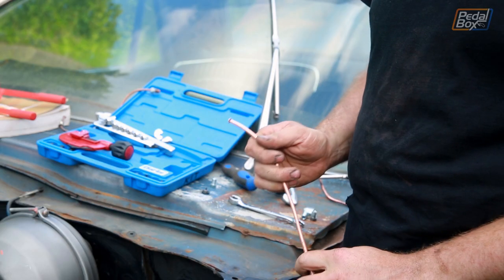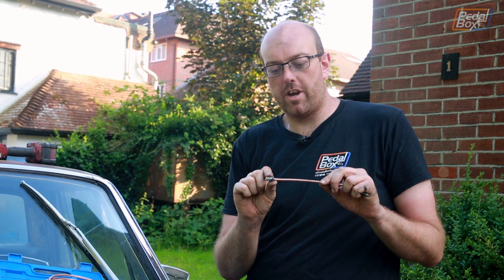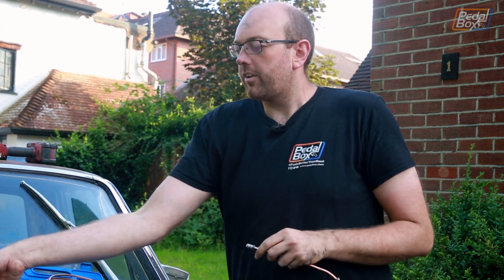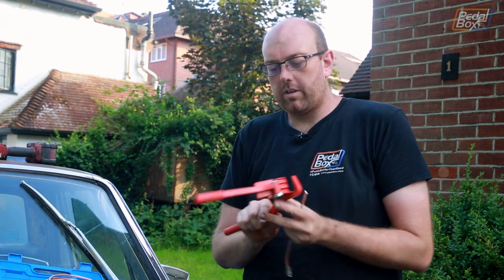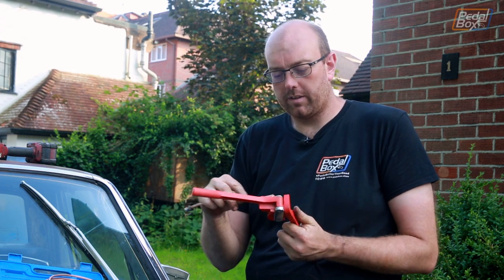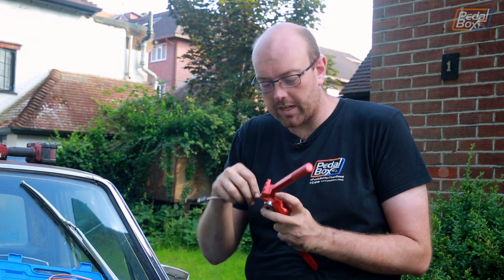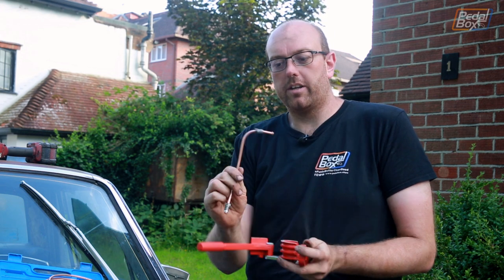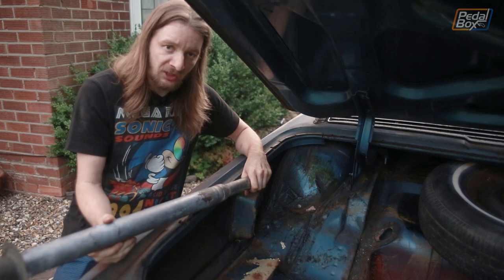And that's a double-folded flare, so this can now be shaped to fit properly. I didn't want to bend it up fully beforehand because with the nut where it needs to be I wasn't going to be able to shape it properly — with the nut only about that far down it makes life a lot more difficult. This is just a fairly cheap set of pipe benders — these actually came off Wish of all places. Make sure the nut is on the right side of where you're going to put the bend in, because that's a massive mistake you don't want to make and have to redo. You just fold it around to get the desired arc — it doesn't crush the tube and it gives you a nice even bend.